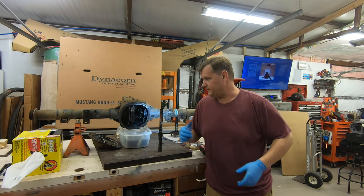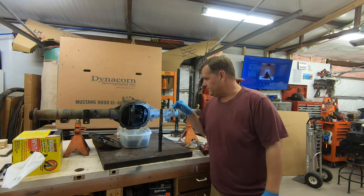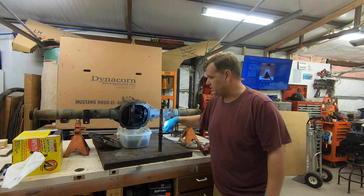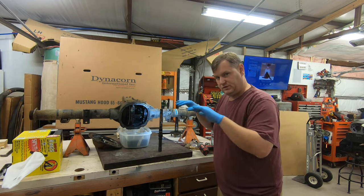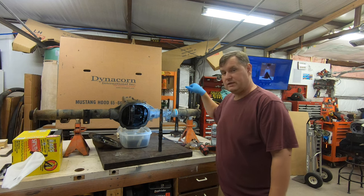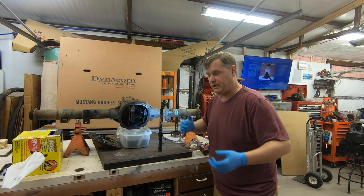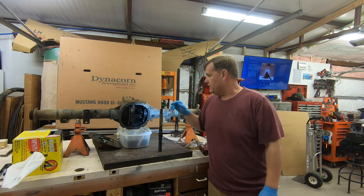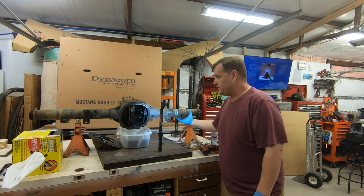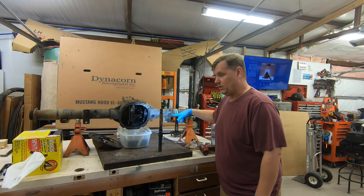At this point I've got the bolted-on stuff stripped off, the axles out, and the pan off. I let this drip for a couple hours - I turned it the other way because there's a huge reservoir down in here that catches a lot of oil. There is still oil in the axles because of the shape of them. For right now I'm going to put the cover back on, slide the axles back in just to keep dust out - not going to put the pin or anything. I'm going to start cutting off all the extraneous pieces we don't need: the original spring perches for the Explorer and the sway bar mounts - both of those are going.